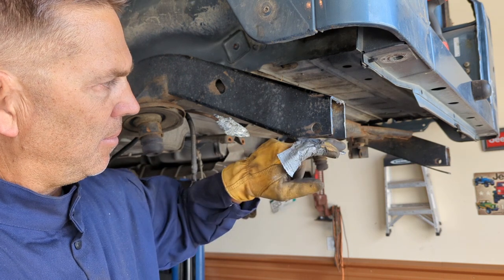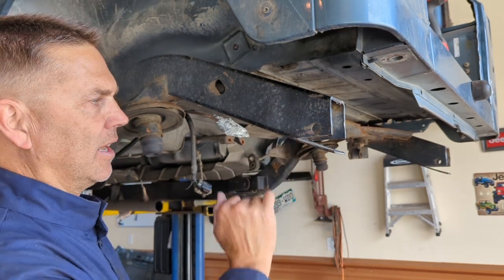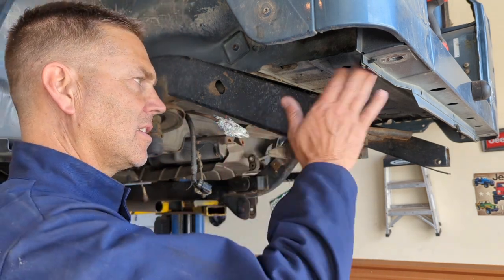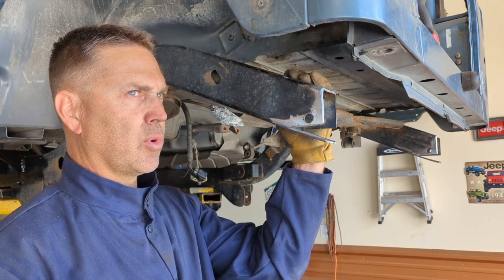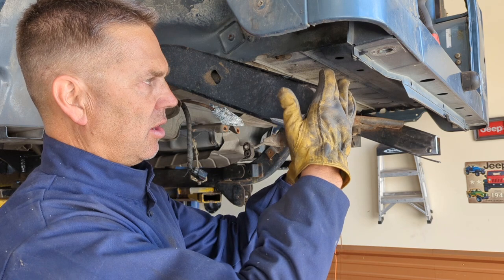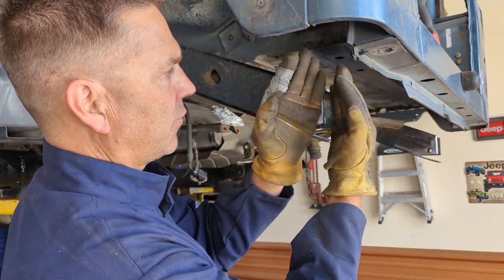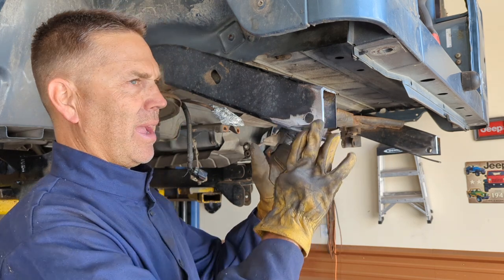The relief cuts are made and we have a fish-mouth shape. One thing I remember from last time is that before bending this up, we had to put a little relief cut a bit deeper to get it to bend because there's too much material — you may need a sawzall to bring it all the way back. Now that the pie cuts are done, time to clean everything up, get it polished and ready for weld. I cannot stress enough the importance of putting 45-degree bevels on all four sides — both frame rails and the cross member. If you just butt weld without bevels, the weld will be shallow with no full penetration. Two 45-degree bevels give you a nice channel for a good weld bead.